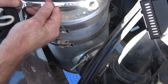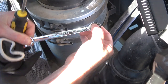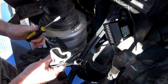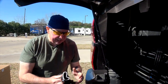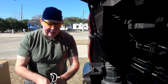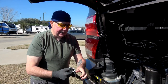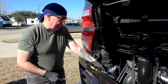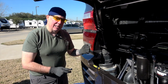On this coach it requires a 7/16 wrench. You have to thread it back a pretty good distance to get it loose, so I recommend a ratcheting set — that's ideal. Safety first: I've got my glasses on because I will be going underneath the motor coach to drop that down, and I don't want anything to fall into my eyes. I always try to use safety glasses and protect my hands a little bit too, because the clamps to remove the canister that hold it onto the engine can be tight sometimes and will snap.